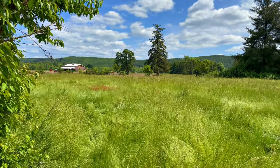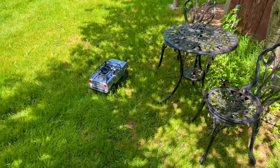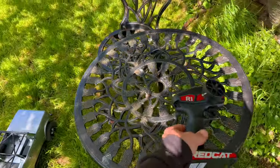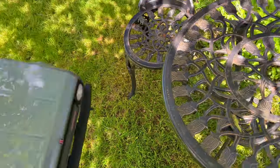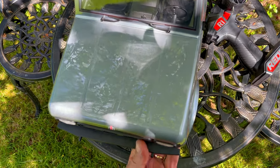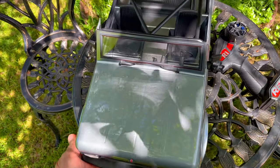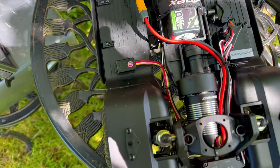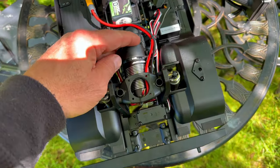So, Kelly's been doing her little art crafty things there, and I've been working on this Gen 9, getting this thing sorted out. I took the transmission apart, greased everything, got her all dialed in. And it's funny, bench testing the thing without the cover on it, I think the cover resonates most of the noise. You're just hearing a lot of spur gear noise in here.